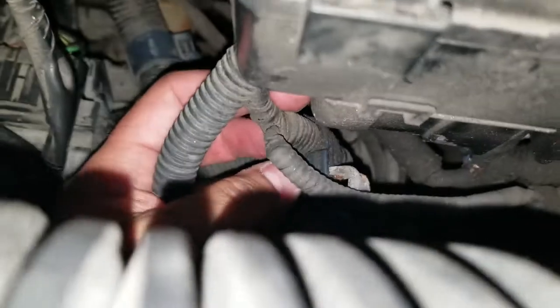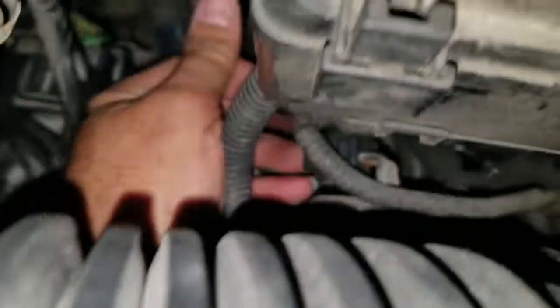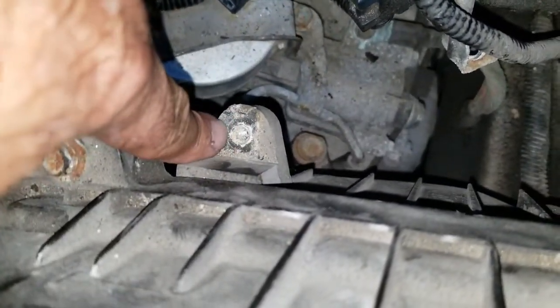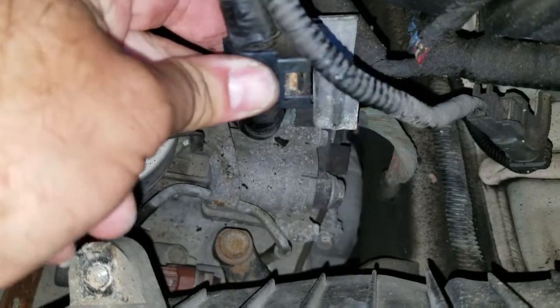There's a little something on this side. Once you start juggling this out of the way, you'll find there's a cable here that just slides off this bracket — you just have to get that off. I struggled a bit trying to remove that from the bracket, so what I ended up doing is removing the 8 millimeter bolt attached to the air intake unit. There's a little clip you're supposed to squeeze and pull, but there was a lot of crud preventing me from releasing it, so I took the easy way out and just removed the bracket.